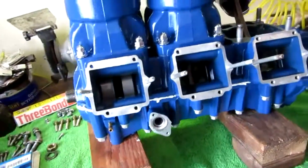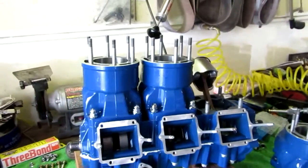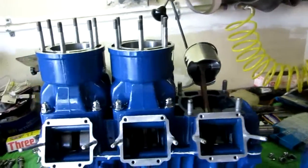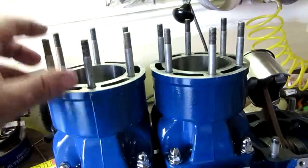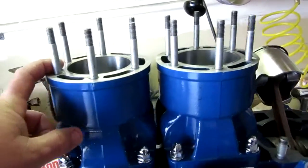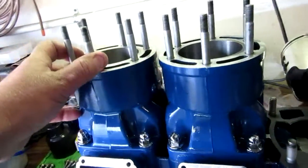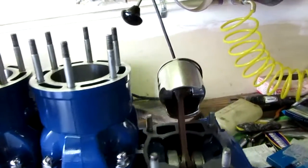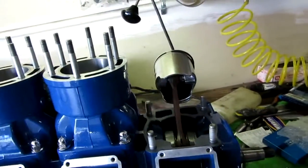We had an index that was off on the crank, so we replaced it with an SBT crank and replaced all three pistons. The front one was actually starting to get a little melted — could have been from a carburetor or a lean condition, because it wasn't real bad. But the back one was melting holes in it because the index was off. We're going to be checking the index next just to make sure everything's okay.